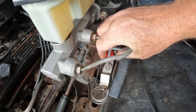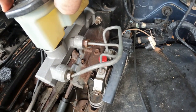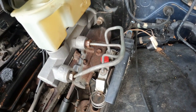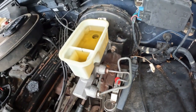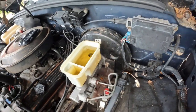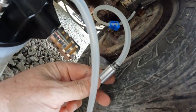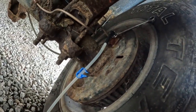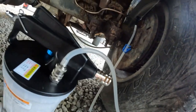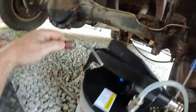This is something they started back in the 70s with this proportioning valve when they started going to disc brakes in front and drums in the rear — so you want to favor the front brakes. It's a safety device for that. Now that we've got the spool locked, the spool can't move. I should be able to hook my bleeder up to the rear and work my way back to the front. I want to take this cap off so we can keep the reservoir full while we're bleeding it. I want to bleed everything until clear fluid comes out all four wheels. This kit also has a one-way valve so whatever it draws out, it can't let air go back toward the wheel cylinder. I'm ready to hook this thing up and give it a shot.